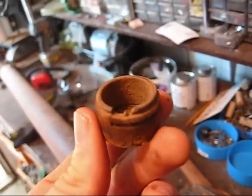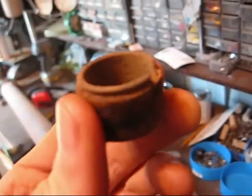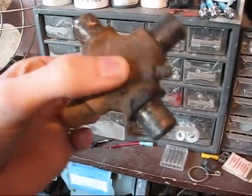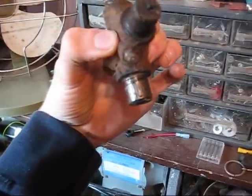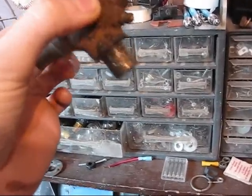See, this one's pretty bad. This was the welded side — it's all cracked, cracked right down the side. Not in the best condition. There's grooving here. That's a sign that the needle bearings are just not moving how they should and they're grinding right in. And that's a sign of a failed U-joint.